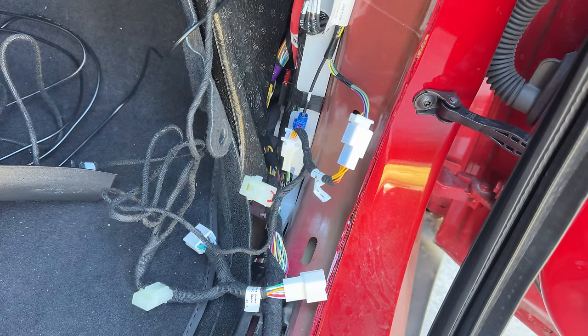In the next step, lay the cable flat on the dash and put some masking tape. I know it's an added step but it makes your life much easier — you don't want cables getting into the clips when you put the dash back. It could ruin your cable, so just put masking tape to organize this. After removing the dash unit, it's all about passing these three wire cables through the air vents. The display has four different support pillars which is really nice — we are going to put the screws from the bottom to secure it.